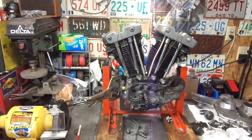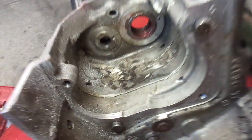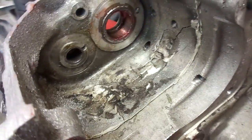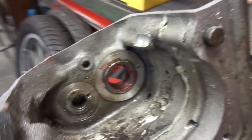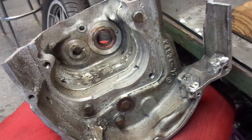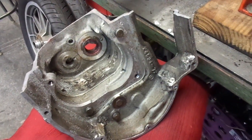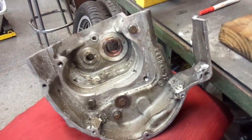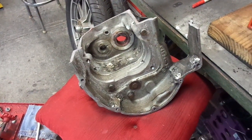There was slop on the clutch hub. Pulled the transmission — I'll show you — you can see what I've done. I pulled the transmission out and the whole inside of this case has just been blown out. The welded main shaft wasn't fitting, 23 roller bearings weren't fitting, the main shaft itself was just scorched. Six of the 11 primary cover bolts that hold the cover on have all been repaired. It was just one thing after another.